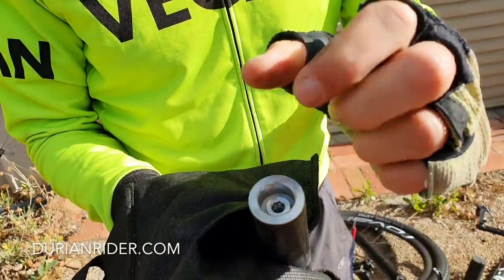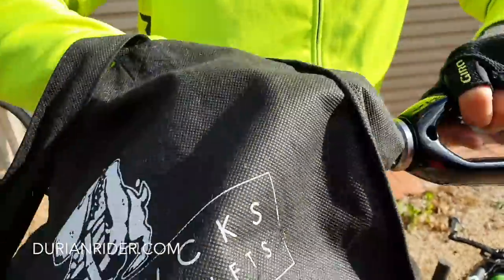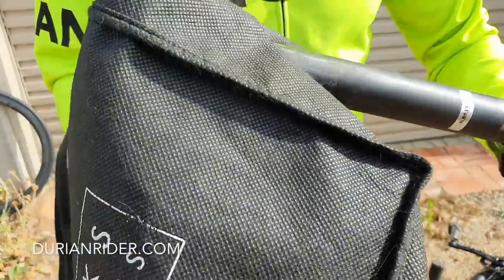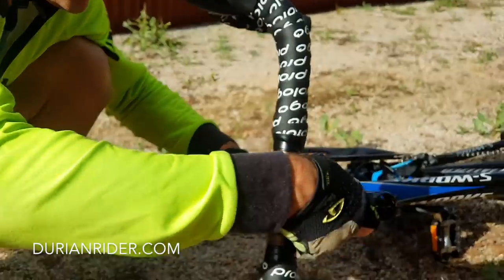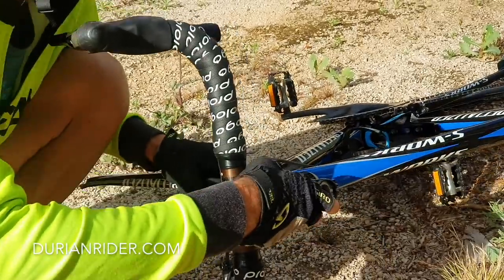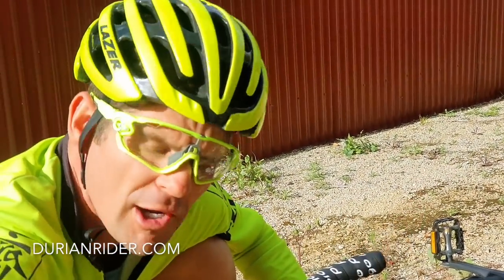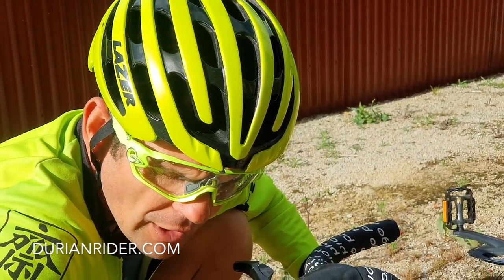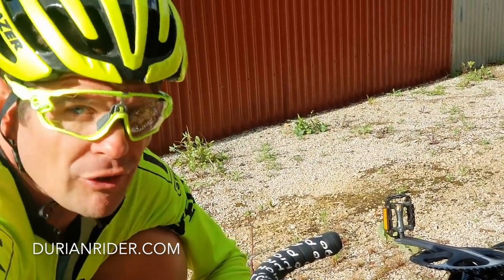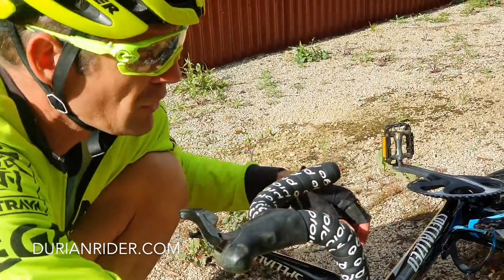I'm going to take this out and shine a torch down there and double-check that. A bit of spit and polish. Spit on the shaft, move it up and down. Look at that — nice and clean now. Polished that shaft. I've checked the fork, I've greased the bearings, I've given it the full-on A-grade gold standard safety check in my opinion. You could take your bike to a bike shop — some people say I'm not a trained mechanic, and I'm not — but I'm very thorough when it comes to these headset areas. Most bike shops don't even do this.